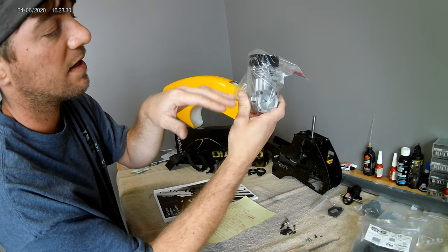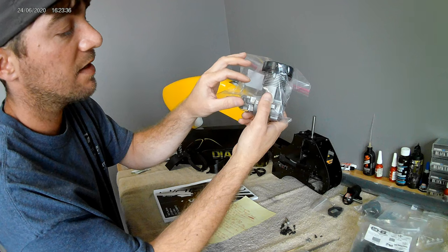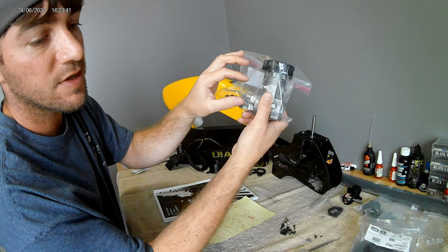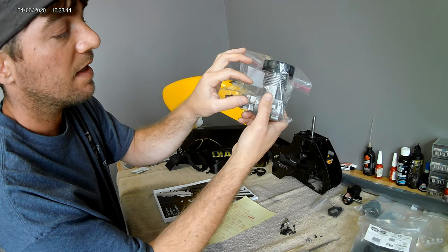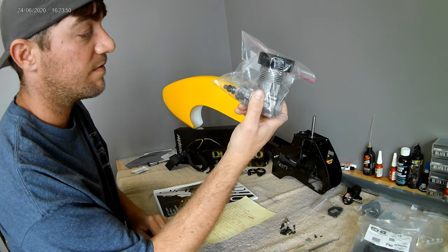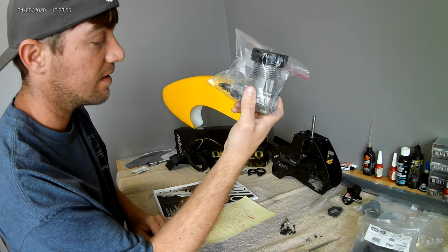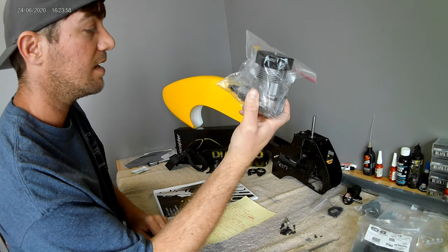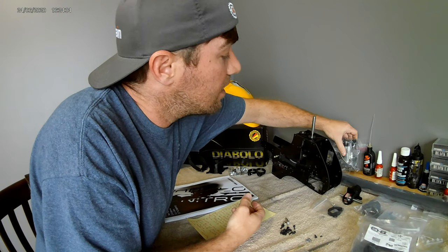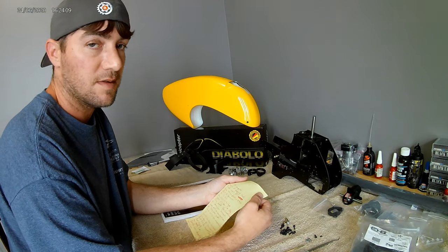I modified the 96 SRX — I did crank work, casework, and even modified the piston. I'll be running what's called a power tune kit. You can look up Gregor McGrath or Jay Treadway on Facebook. It's a conversion kit that allows you to run an OS carb on the YS, and I've already tested it on a YS 120 SRX. The OS carb is leaps and bounds better than the YS carb regulator setup — much finer tuning, way easier to adjust needles, and it all-around delivers fuel better.